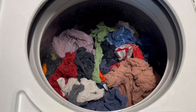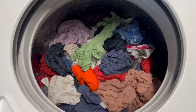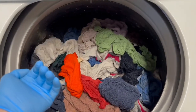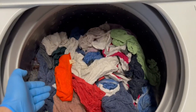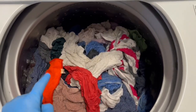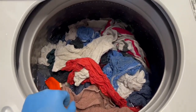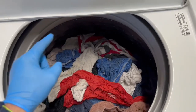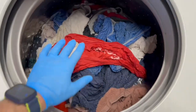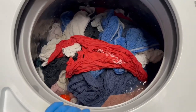How this works is it's kind of the idea of a front load washer except turned vertical. The agitation plate moves along the bottom forcing the clothes up the middle, out, back along the sides, and down — just doing this vortexing cycle. So the clothes are not only agitating along the bottom plate but agitating amongst themselves back down into the water. Like a front load washer, the clothes tumble in the soapy water, giving you more space in the middle without an agitator.